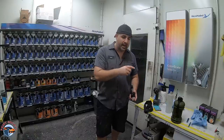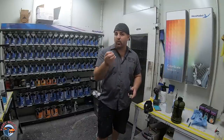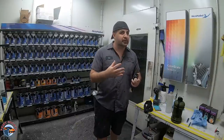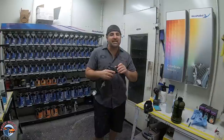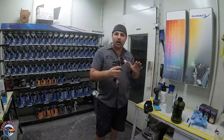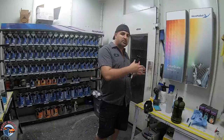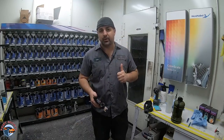The 1.2 that I have in the gun actually breaks up the clear coat much finer. So I knew there was a problem and I had to go back and figure it out. It's not the world's best clear coat gun — it's probably not going to be the best clear coat gun to do large panels, but it fits the small job pattern technique of spraying. A smaller bumper or accessory piece — I think this gun is more fit for that. The 1.2 is really where it's at with clear coat.